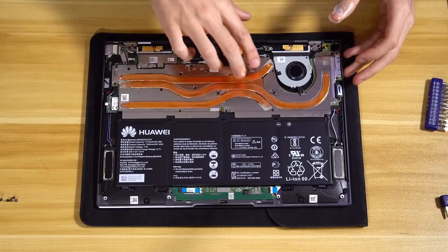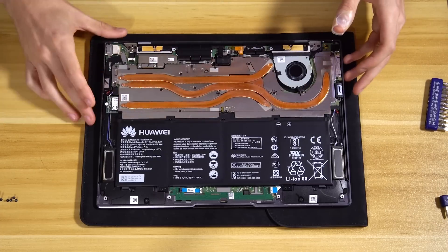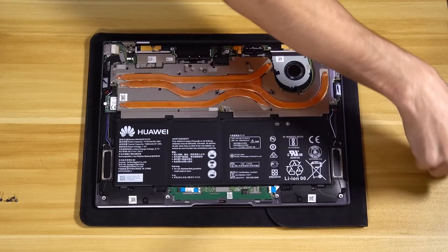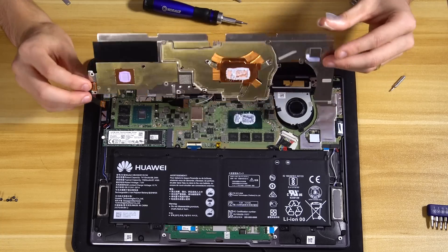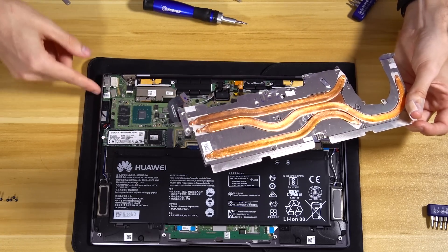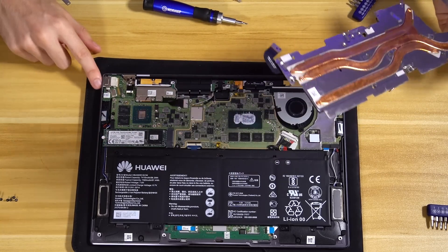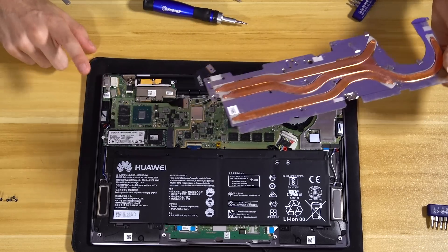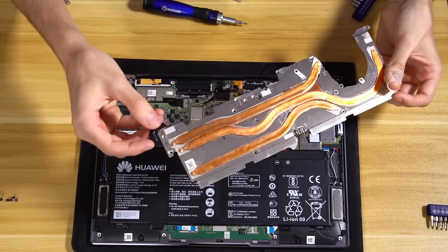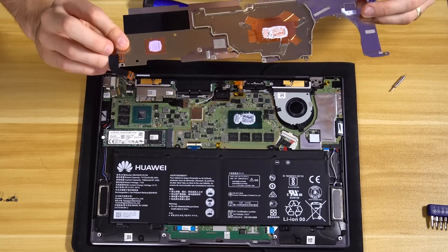We need to get to the dies of each chip so we can apply our liquid metal solution. These look like small Phillips heads. There is one ribbon cable to mind — it's connected to the heat shield and ties both logic boards together. This is the motherboard here, and this looks like the USB-A section of the laptop. Keep this in mind — you don't want to rip it, it's going to be a pain to reconnect.